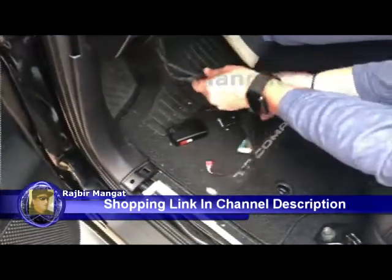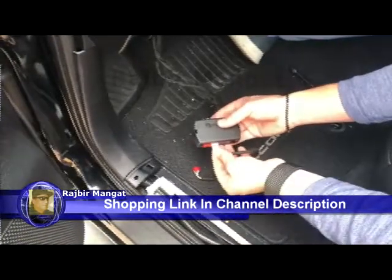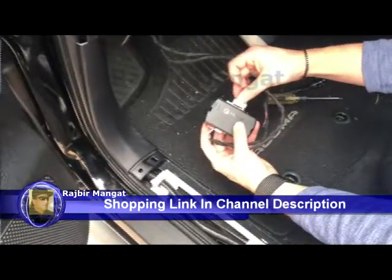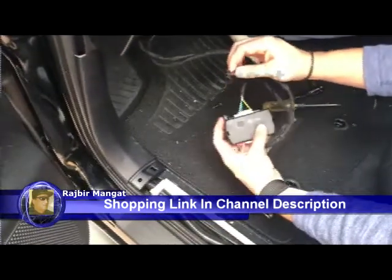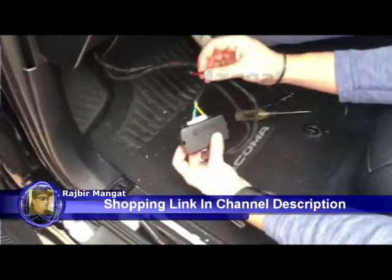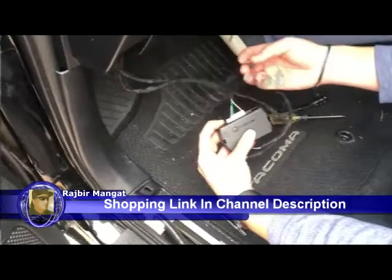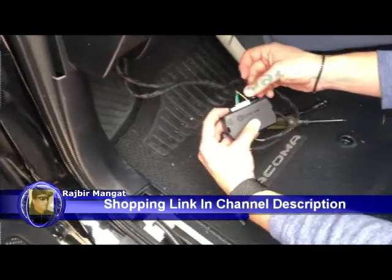Right now the harness is connected to the car. We'll go ahead and finish the connections to the front module. We'll go ahead and plug in the white and the red connections on the side, and the larger black connection on the side. The remaining black connection is going to be used in programming — this provides power to the module. You'll see a programming button on the top side of the module. Press and hold that button in while you connect the black connection. You're looking for a solid blue light.